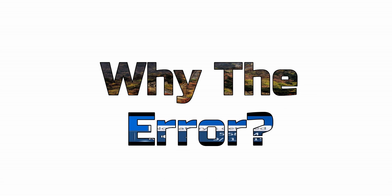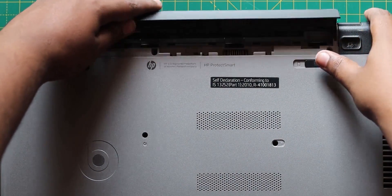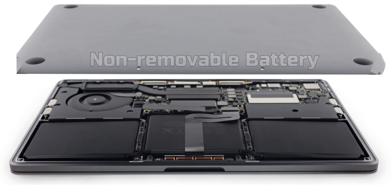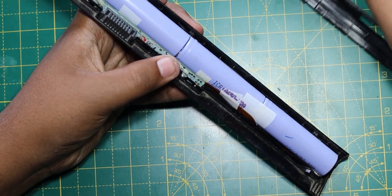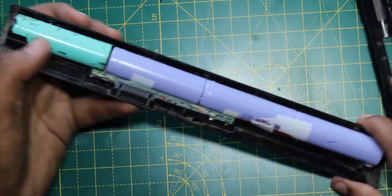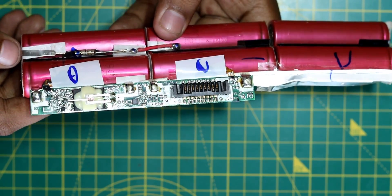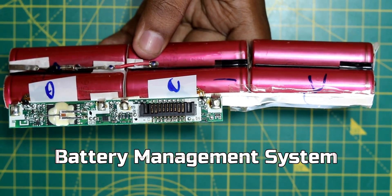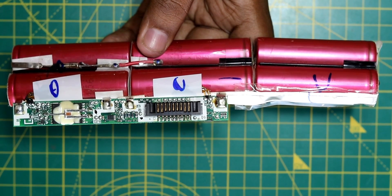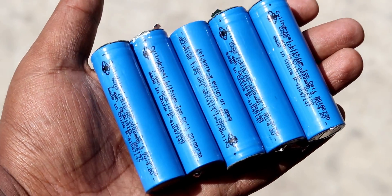Let's try to understand why the error is showing. Every laptop has a battery pack inside it. In some cases it may be removable like mine, or it may not be. The battery pack contains 18650 batteries for running the laptop. If you open the battery pack you will find there are three or four batteries connected in series, and a PCB board — which is basically a BMS, aka Battery Management System — connected with the batteries. In 90 percent of cases the BMS is usually not bad, so mainly the problem will be in the batteries.